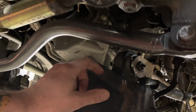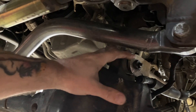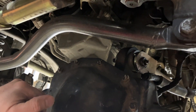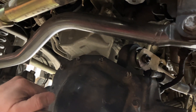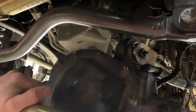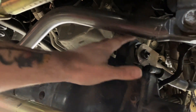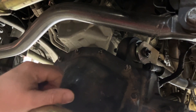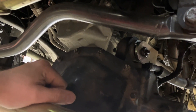Another thing that failed around 18 to 20,000 miles were the upper control arm bushings - they were ripped to shreds. The way I tested that is I had been chasing down death wobble after replacing the Synergy tie rod ends again. We still had death wobble occasionally, so I put a pry bar under the diff housing and this upper arm. With the factory bushings, they shouldn't rotate or move at all like a rod end - they moved like crazy.